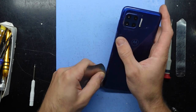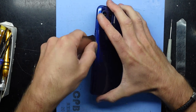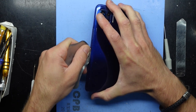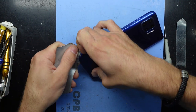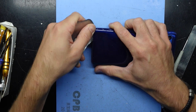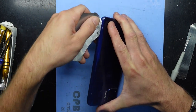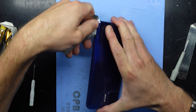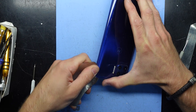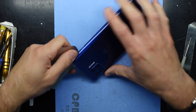I'll just pick any corner — I don't know if that matters just yet. The aid of the heat and the isopropyl should soften the adhesive enough that I can get in there without causing too much drama to either the back plastic or the internals. I feel like this is either hard plastic or glass, so I'm not wanting to bend it too much. I'm just working my way around the perimeter. I can feel that when it has actually unbonded, I can push the pry tool in a little bit further, and when it's like that I can usually move it quite easily.